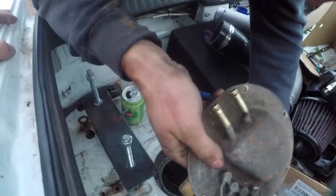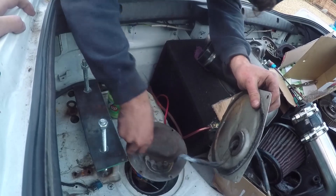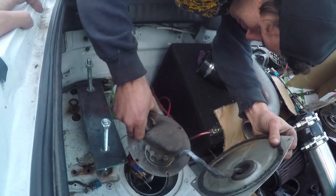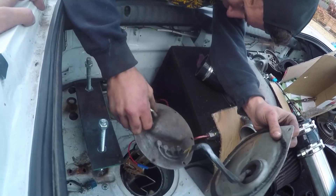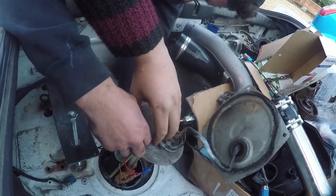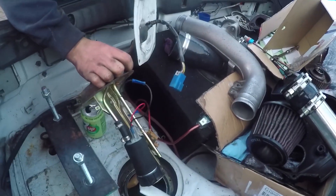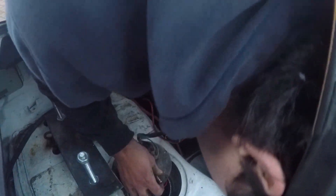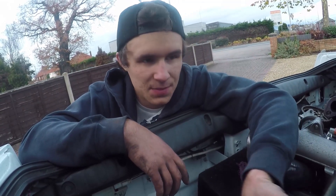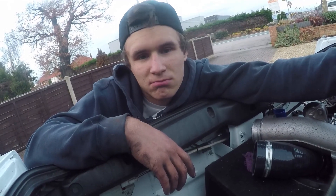To be honest, this is probably the hardest bit of installing the fuel pump — putting the pump back in — because you've got to get the face in the right way to get it on those pipes. You've got to get it in the right way... rotate it... yeah, it's gotta match up with those pipes. There you go. So that's how you put a fuel pump in — it's back in the car now, back in the tank. All that's left is to do the bolts up, put the feed and return hoses back on, then put the battery on and turn the key to see if it primes. Yeah it's gonna spill some fuel on the floor, but fuel evaporates pretty quick.